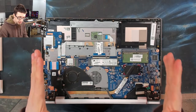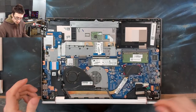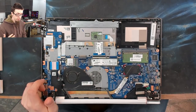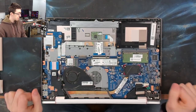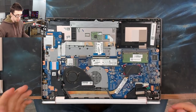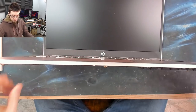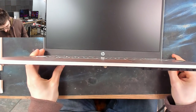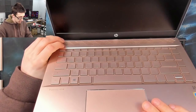These HP Pavilions do not have CMOS/RTC batteries in them, so taking the battery out and disconnecting the charger also functions as a BIOS reset. I'm going to leave that for a minute or so — this has probably been long enough while I waffle — and now I'm just going to plug it in and try it again. With the battery disconnected, I'll just plug in the charger and give it another spin.